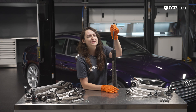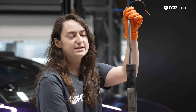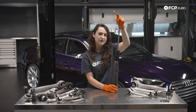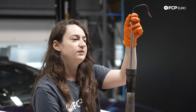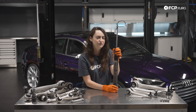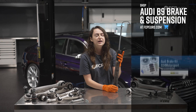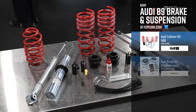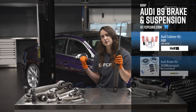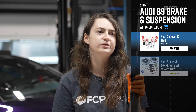DCC stands for Dynamic Chassis Control. This allows you to go through Audi's drive select system and specifically hone in on the type of feedback you want from your suspension. You can change the firmness or softness depending on the settings of your choice. This is all electronically actuated and it's a relatively smart system. There's a lot of benefit to this system if you like driving your car in various different driving styles. If you're someone who just daily drives it, this might be an overkill system for you. We do offer DCC delete kits if you want a more simplistic suspension system. That is exactly what we did when we had the H&R coilovers put into this example here — we converted to a coilover setup with a DCC defeat kit.